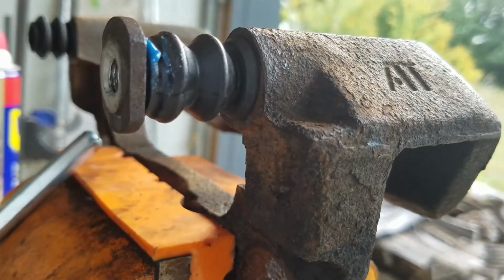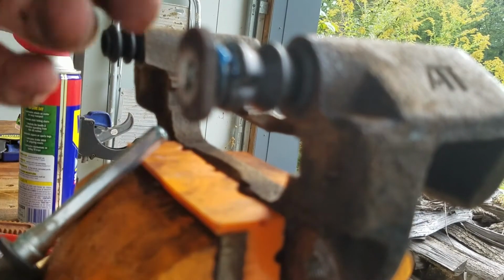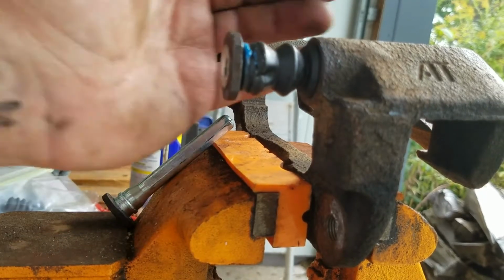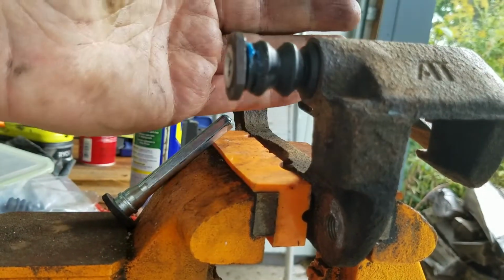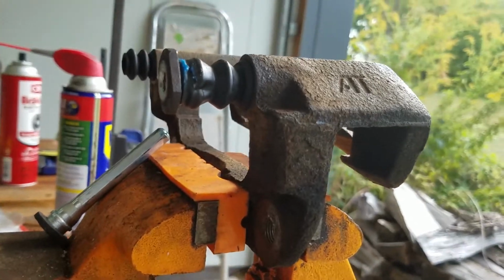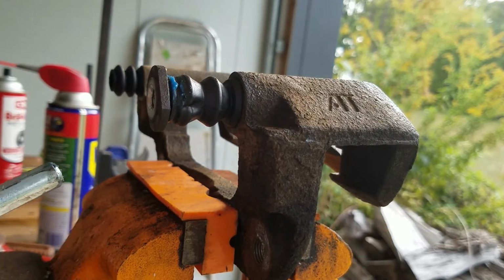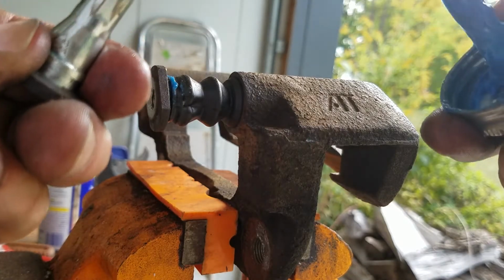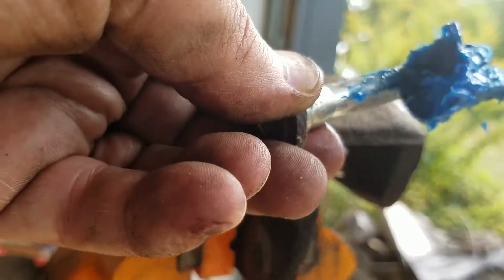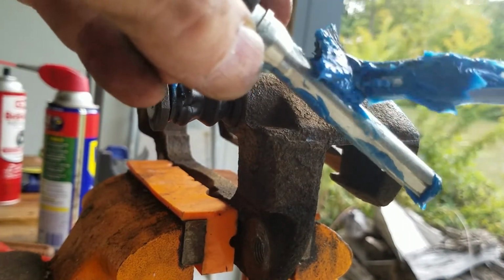You can see it really pulls it out. It really wants to push the brake pads out when it's functioning properly, and that's kind of what you want right there. It will be a little tough to put it back on because it likes to push it back out. So that's really what you want these to do. Again, we'll put some of this on the edge, and then the top one has got these flats. So we'll definitely fill that up.